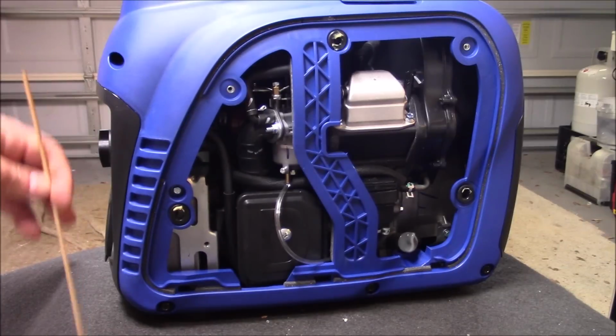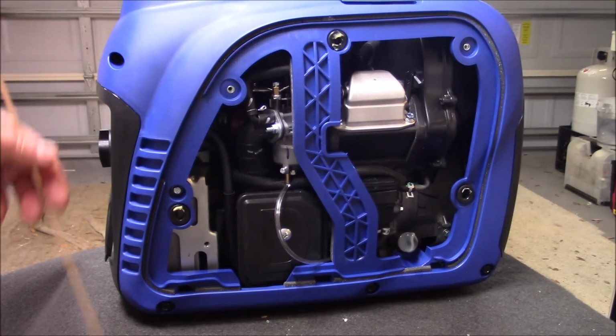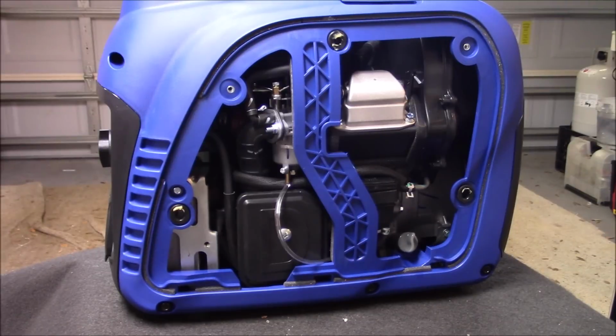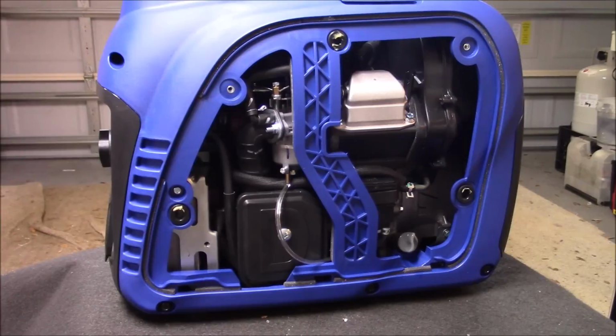They're extremely dirty. They're black all over on the inside. And they're Torch spark plugs, so I don't know the particulars of the Torch line of spark plugs or what their particular reputation is, but I don't have good luck with Torch spark plugs. So in both of these units I've gone ahead and put the NGK plugs in. Just double check with the manual and they'll tell you what the recommended plugs are for this, and then you go to a reference chart and pick out what type you want. So right now I currently have an iridium plug in there from NGK.